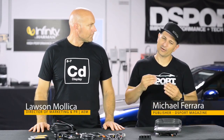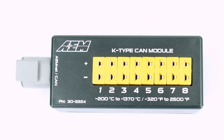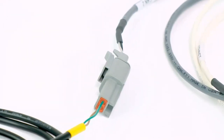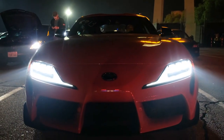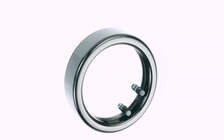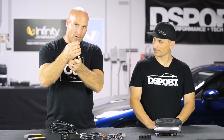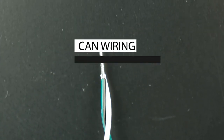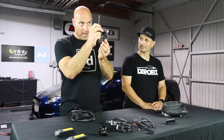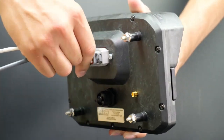So Lawson, we got a little bit of an idea of the CAN technology and what it can do when we talked about the 8-channel EGT. Now, let's say we've already got that CAN connection on our 2008 and later vehicle. What are some of those modules and things we can add on? One of the things that might surprise you if you have our X-series wideband is that you've already got a CAN output in your car and may not have even known it. We provide for that on the harness — you have these two twisted wires. We tend to make them white and green. You can always identify CAN wiring because it requires, at minimum, one twist of the wire per inch.